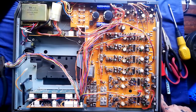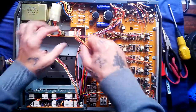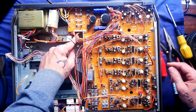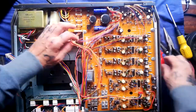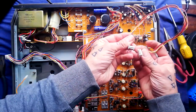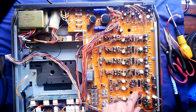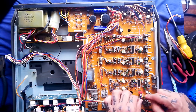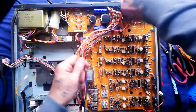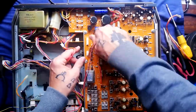Continuing our disassembly of the Teac 144, let's detach the cables connecting this RP amp to the rest of the system. There's a double-ended cable here connecting to controls for the tape cue, marked as 2VR. You can probably just pull them using the strength of the cable, or if you're feeling cautious, jam a flathead screwdriver in the space to get them out. This five-pin plug at each end — this cable here goes to the mixer.